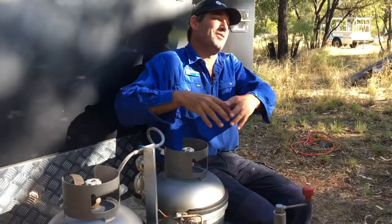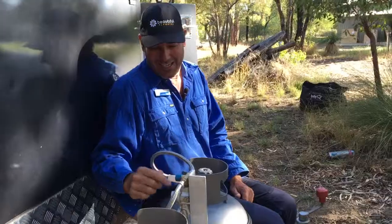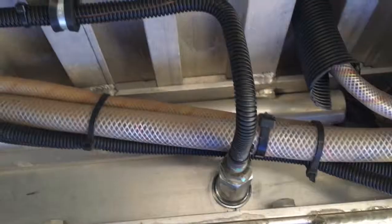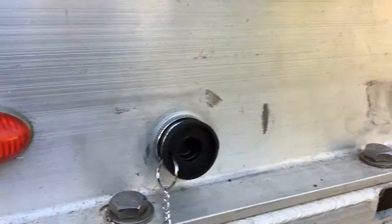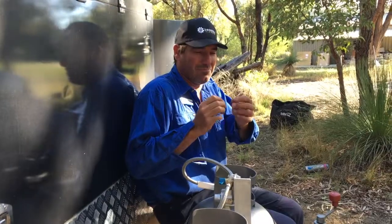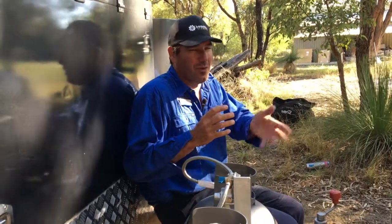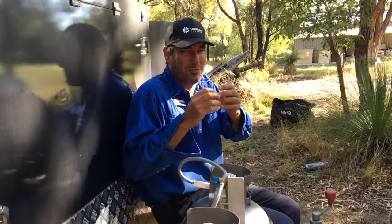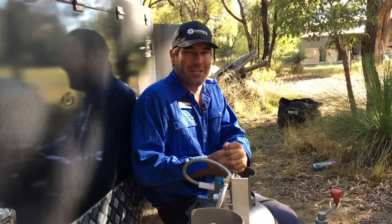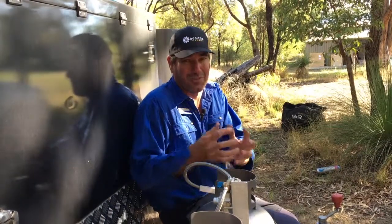So once we ripped out all the illegal hoses, I made up a new aluminium bracket — rock solid — to support the new gas regulator so you can hook up both bottles. We ran a new gas line all the way down to the back and installed three gas bayonets, connected them all up. Now wherever we can, instead of using flared joints, we try and weld all the pipes together. Because rocks and vibration can sometimes cause those flared joints to come loose and start to leak — less chance of that happening with a welded joint. And welded joints, when you can get them on the job, they just look beautiful.